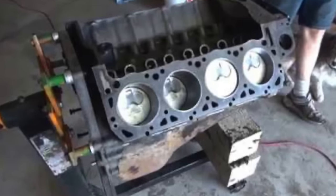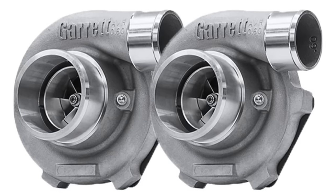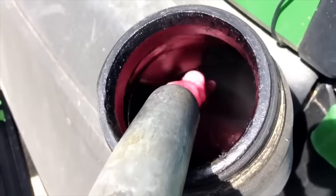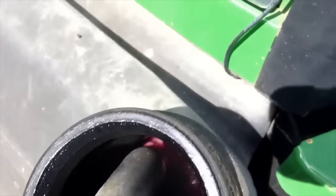Supposedly, this engine was a stock wet block 7.3 IDI, sleeved down to a 6.9 IDI spec, had a 15.1 compression ratio instead of the 21.5 compression ratio they came with, ran twin Garrett turbochargers with a boost pressure in the manifold of 147 PSI, ran on normal diesel but through a built P-pump instead of the DB2 rotary style pump,